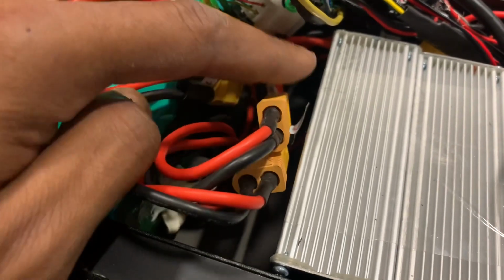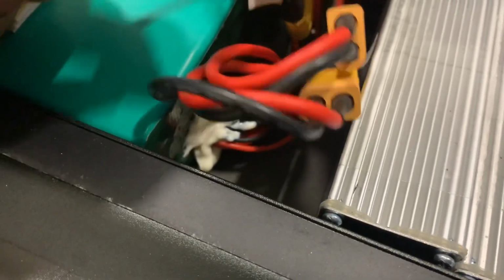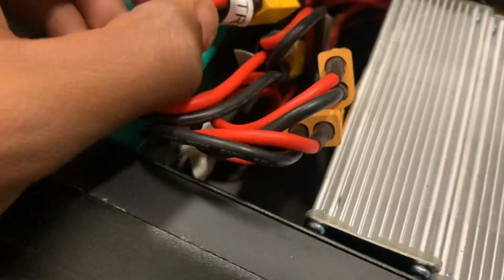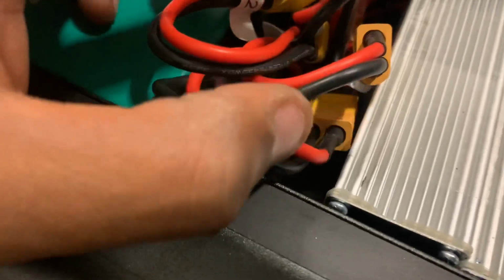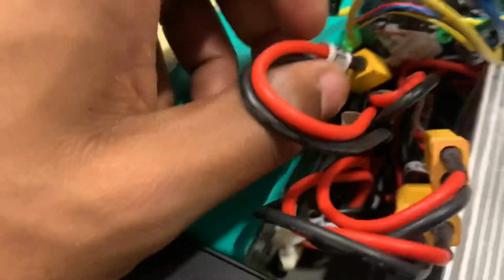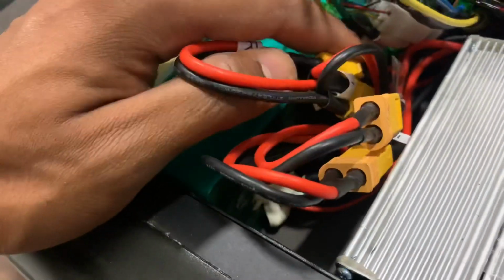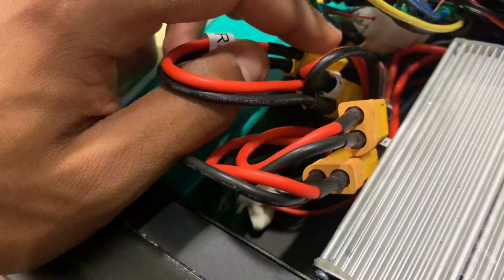So you're gonna disconnect the controller output from the battery. You'll see there's two of these wires originally before you even start to add your wiring harness. You'll see two wires coming out of here connecting to your two controllers. You grab those, make sure you keep controller 2 with controller 2 and its positive connection to the battery. Keep those in parallel, or keep those as close as possible. So what you'll do is you'll disconnect it, boom, and you'll plug in the battery into the opposite connector, and then you'll plug in the controller into its controller connector.